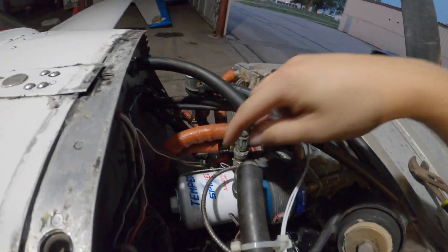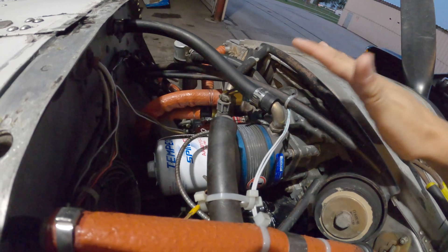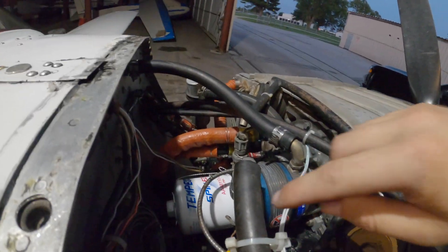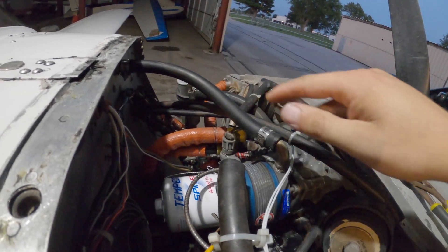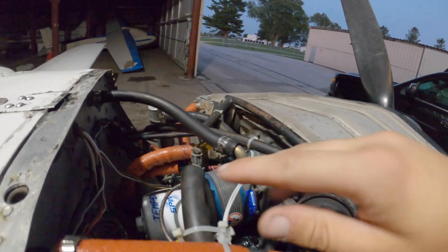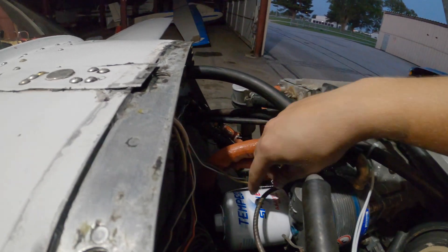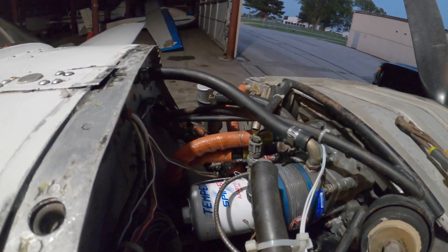So while that's draining I'm going to go ahead and pull the oil filter out, which is in a really terrible spot on these. Moonies are notoriously tight and this is kind of the bane of my existence with these oil changes. There's absolutely no way to get a rag or anything underneath this filter, and a little bit is going to drip out when you pull that filter out. So you really have no option but to make a mess — it'll drip oil all over the cowling and all over the nose gear, and you just have to clean it up later. So we're just going to go ahead and clip the lock wire for this guy, and I don't have a wrench that'll fit, so I'm just going to use channel locks to loosen it up.